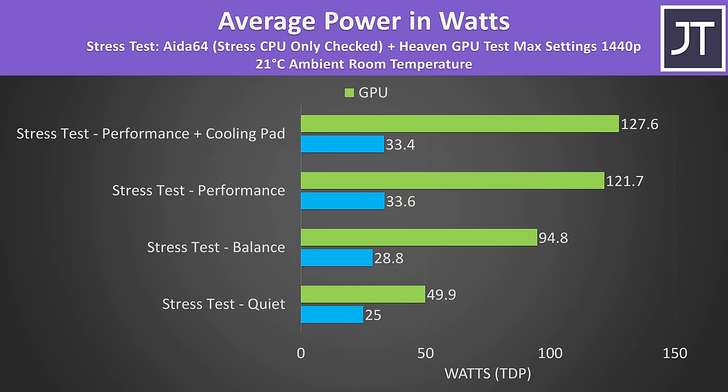The CPU wasn't running hot because the 6800H is running at just 33 watts in performance mode. The all-core clock speed was 3.7GHz, which is still decent. For comparison, the ASUS TUF A15 runs the 6800H at 45 watts and hits 4GHz, but the trade-off is 95°C for 300MHz more speed. The RTX 3060 wasn't running at its full 130 watts without the cooling pad due to thermal throttle. Most games won't max out both CPU and GPU simultaneously, and based on game benchmarks, it doesn't appear to be negatively affecting performance under normal circumstances.